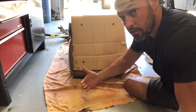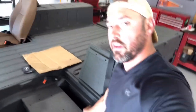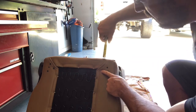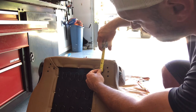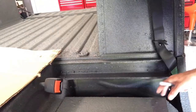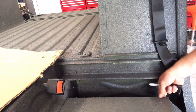Okay, so there you have it. Traced them out, just measured them out on center, then diagonal — it's pretty on the money. Now the template is good, now it's transferred over. So I just measured to the back where it hits right here — the back of the seat — and it's an inch and a half of overhang of the back of the seat from the back edge of the plate. And now what I'm going to do is measure an inch and a half past this point from this back hole. So that's three inches, so it's going to be four and a half inches. Actually I'm going to go a little on the safe side — I'm going to go four and three-eighths for the back of the bolt to the back of the seat.